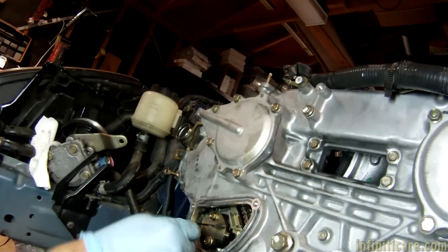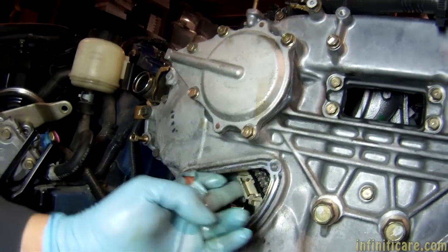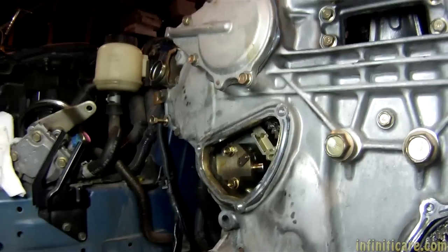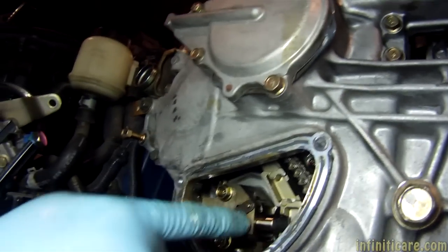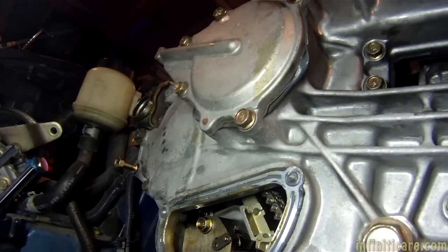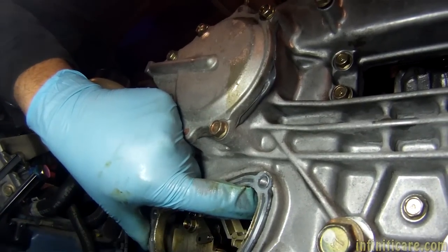So at this point, if you watch the chain when I pull the pin — there it goes. I'll push on it just to make sure it's got no oil in it. The motor has to get started and it'll fill with oil. Without oil pressure this will move back, pushing it back tooth by tooth, but it won't go all the way back.